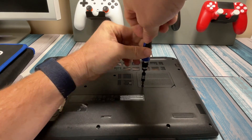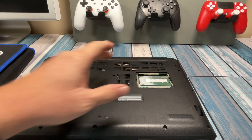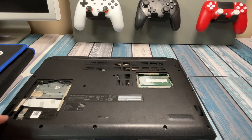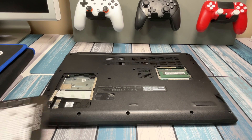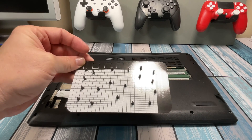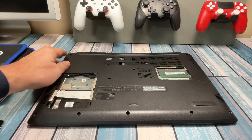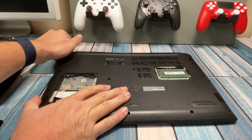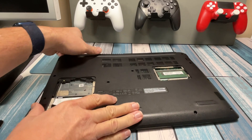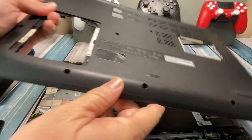Let's open up this door over here — same thing, we're just going to pop that lid open, and this is where we see our RAM. So here's the one RAM chip that we can take out. There's 4 gigs built onto the motherboard that you can't replace, so I'm going to leave that. Next I'm going to take all these screws out — luckily they all look the same size, so you don't have to worry about which one goes where. Then I'm going to grab one of these corners and just try to pop the clips and slowly work my way around the rest of the laptop to take that cover right off.